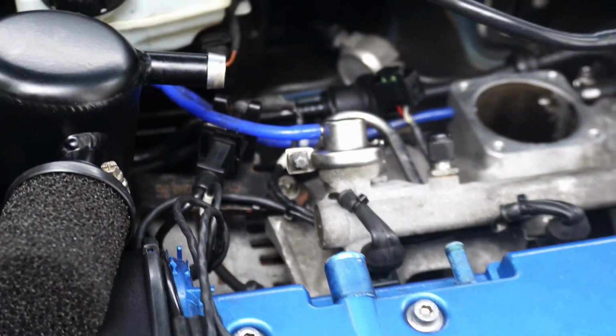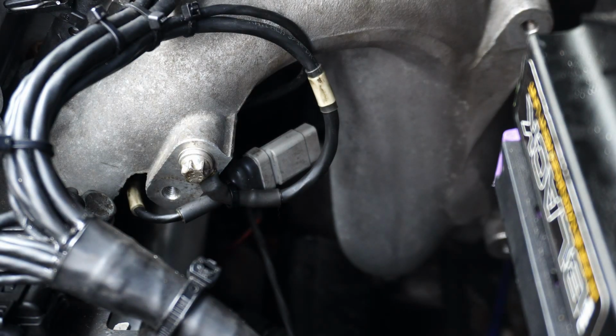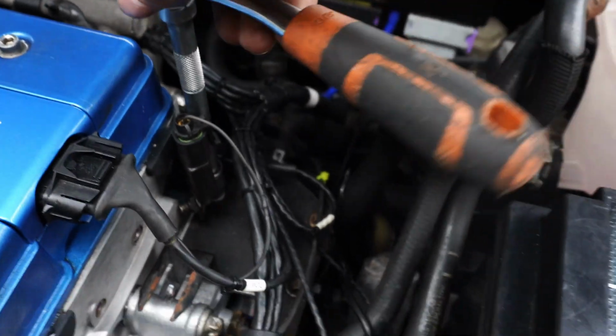With the wiring back where it's supposed to be, I could redo this plug. And speaking of plugs, it's really important to remember to reattach all the grounds for the ECU that you had to disconnect to take the inlet manifold off. Otherwise, you'll be really confused when you get an engine management light and 10 different fault codes for different electrical issues all around the engine.